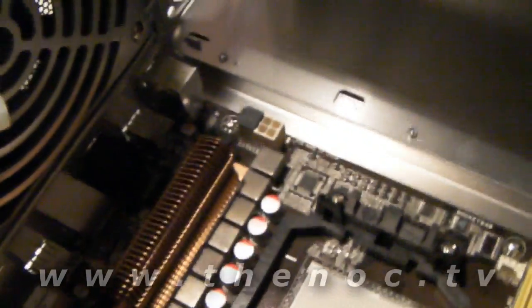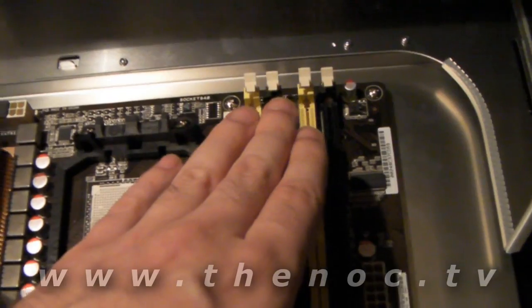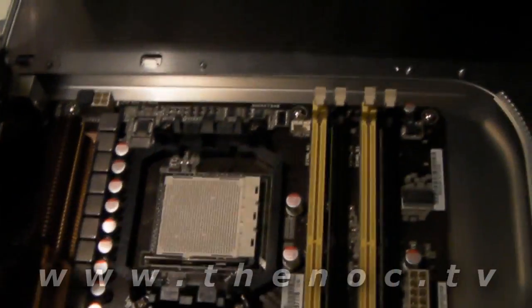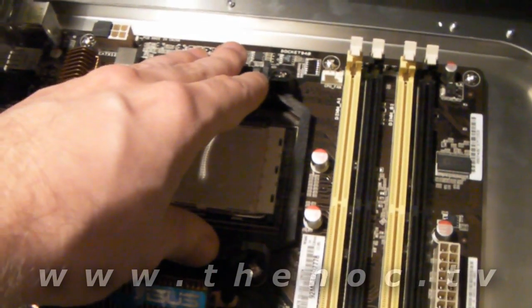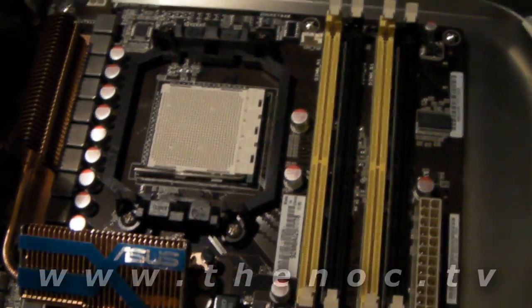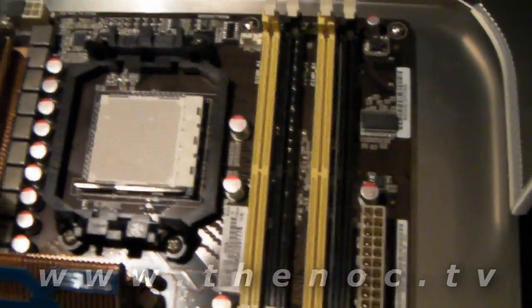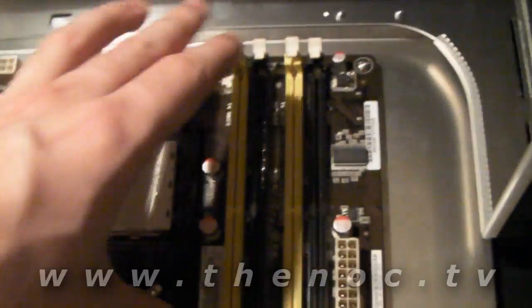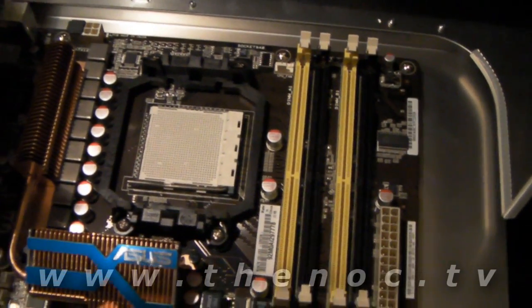I will create a tools video explaining all this. Something I should have mentioned at the beginning: some people will say you need to put the processor and the heat sink on along with the memory before you put the board in. I semi-agree with that. I understand the concept — if you put a whole bunch of force on the processor socket you're going to be forcing it down on the board and it'll cause it to crack. That can happen. But with this particular case the heat sink is just going to clip on, putting tension on the bracket. And memory slots are designed to be inserted while in the system for upgrades, so unless you're using Arnold Schwarzenegger strength you shouldn't have a problem.